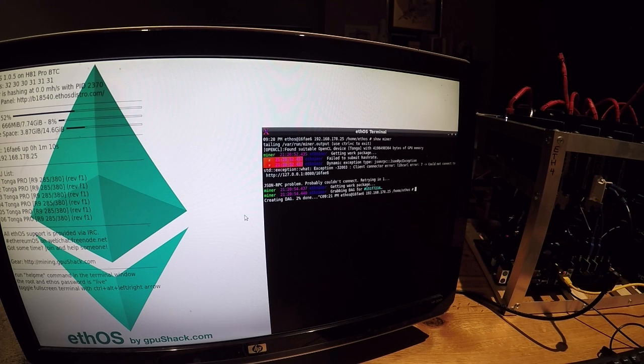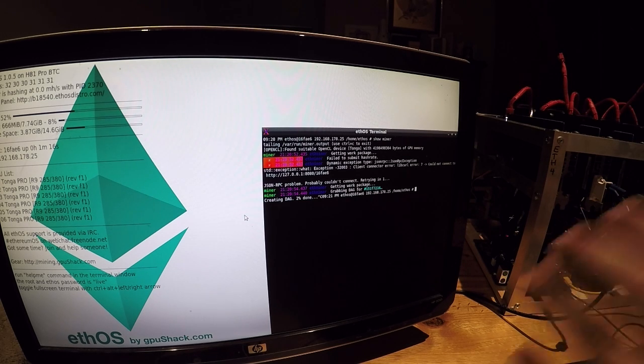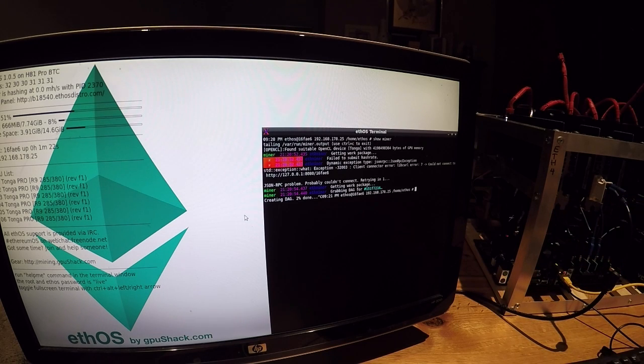I think we didn't get that in the video, the camera was lagging. First thing, when you turn on the ethOS, you need to update the software to the latest version, to 105, and you can do that by typing: sudo ethos-update, sleep 5, sudo reboot, and press enter. I won't be doing that again because I have already updated. It will take about 2-3 minutes.